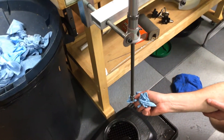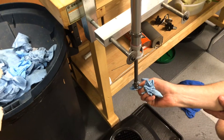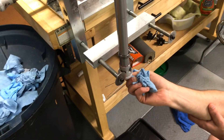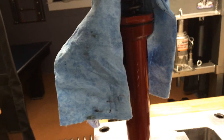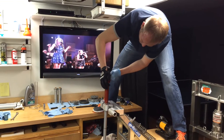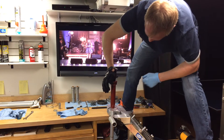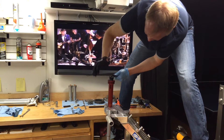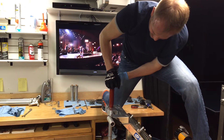RC 268, go ahead. While I'm holding the top as much as possible, keeping some positive pressure, Rich is bringing the rebound all the way in and that is forcing a little extra oil out of the slot bleeders. Just trying to put the IFP in — the final step. We bled it out as much as possible, brought the rebound damper all the way up, and released as much air and oil out of these slots as we can. Now I just need to put enough force on here to get her buttoned up.